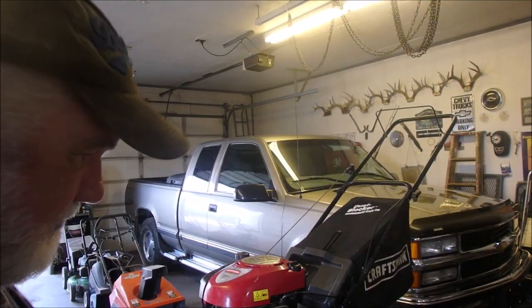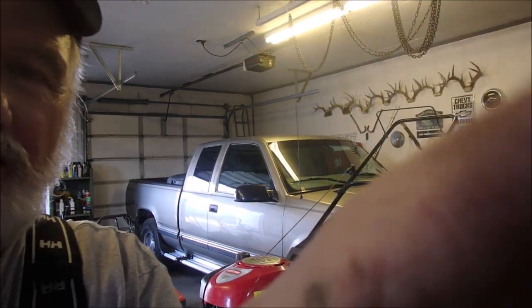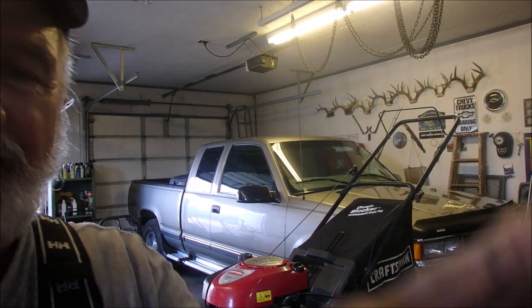So my friends, don't assume anything, right? I bet you there's hundreds of mowers every day, even in my city, thrown away every week because a blade is loose or something's hitting a piece of metal or something like that, and they think the engine's shot. So that was a nice surprise for me. So now we're going to take the spark plug out and we'll see if that affects our quality of starting. Now we're actually entering the tune-up level now, right?